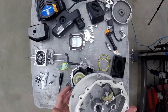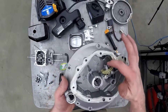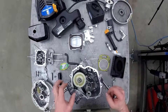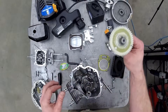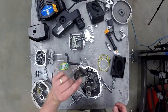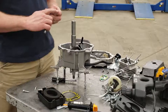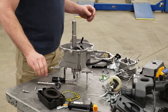You can see the governor gear right there. Normally this engine was missing a little button that sits on there — you need to make sure that it's there, and if you don't have one, come see the instructor. This is the camshaft — it should just slide right out without much effort. If it doesn't slide out, just turn the crankshaft a bit until it does. These are the lifters — I'll pull the lifters out and set them aside. Then there are a couple more bolts left to hold the connecting rod cap onto the connecting rod.